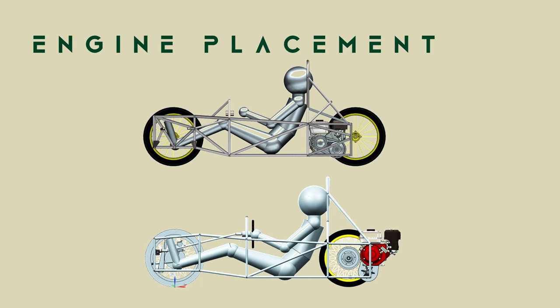For a mid-engine design, you can have a much more compact rear-end packaging. The engine can be packaged a lot lower, resulting in a lower centre of gravity. It has better access to the driveline and brakes, lower yaw inertia, and a more balanced weight distribution. It also has better proportioning — longer wheelbase but shorter overall length. However, it is difficult to access the starter, the feet are in front of the front axle line, and it is a lot more difficult to get the engine out from the roll hoops, making front suspension packaging a little more difficult.